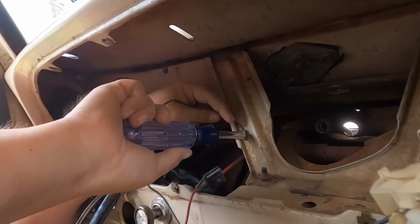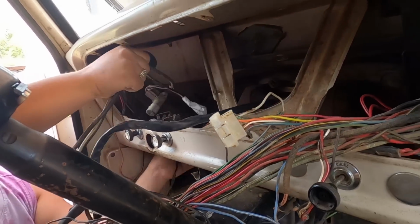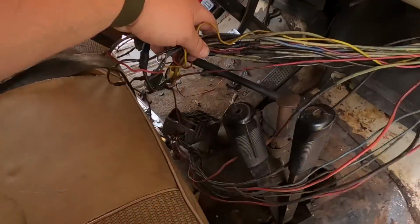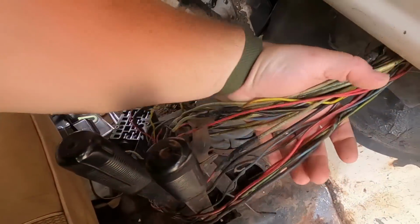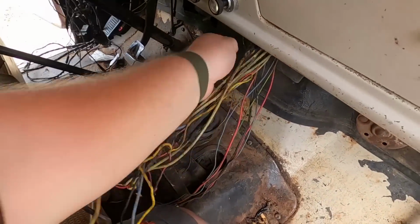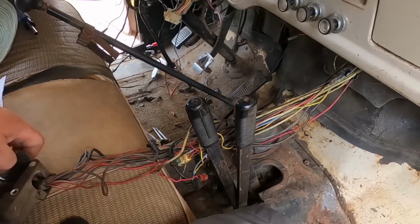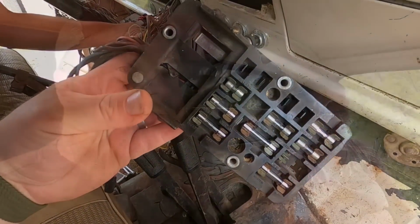They are very organized in how they're bundled together depending on what section of the vehicle they go to. So we'll be running the wires for the engine and headlights up to the engine and headlights, things for the instrument cluster over there, and so forth. It is very complicated and in-depth, with a lot of connections, but the actual wiring and running of the wires is not too terrible. You just want to make sure you take your time. Don't cut anything yet. No pre-terminating. We're just taking out old wires and running new ones to where they roughly go.